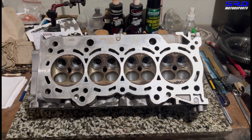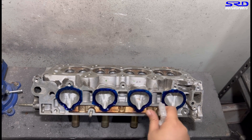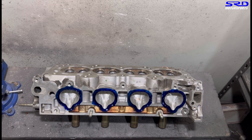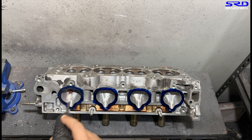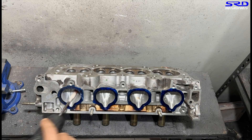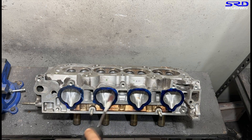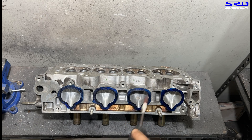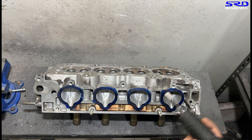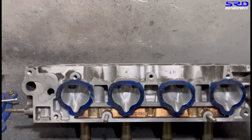Now at the porting bench, we start with lubrication — a 50/50 ethanol and soapy water mix, adjusted with more soapy water since it's nearing summer and drying quickly. This is the second pass on 80 grit. We may do a third or fourth pass to get the texture we need, with proper lubrication, to eliminate all possible bumps or ridges that aren't good for flow.